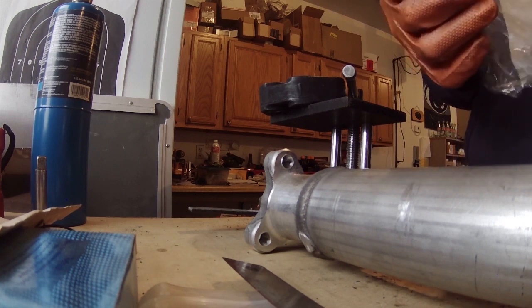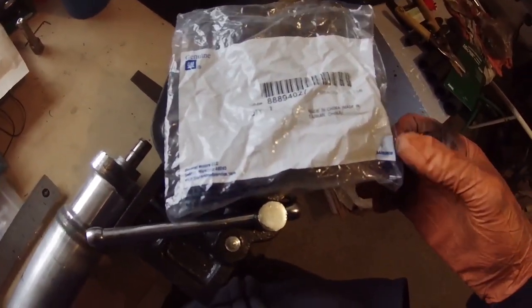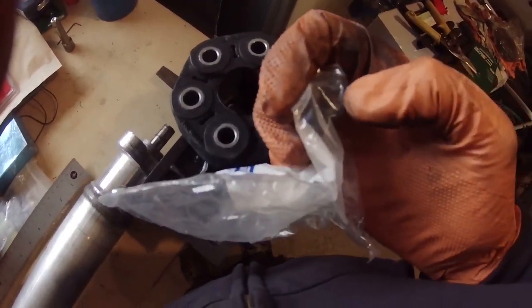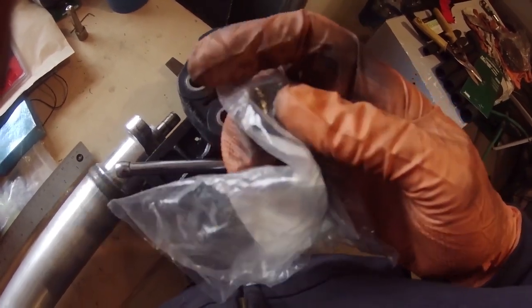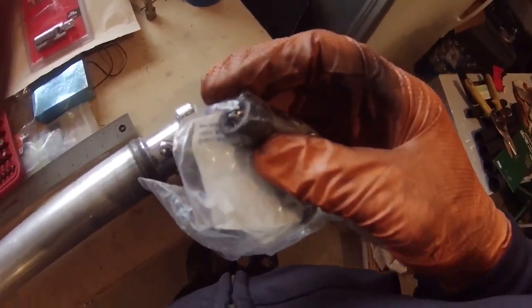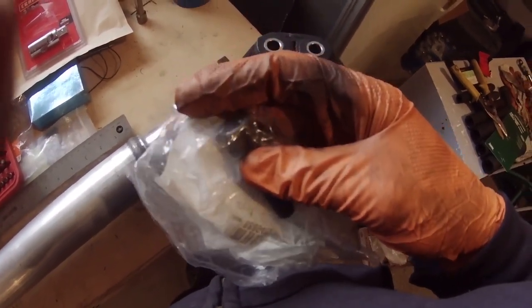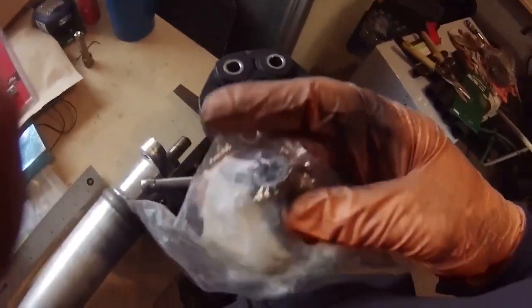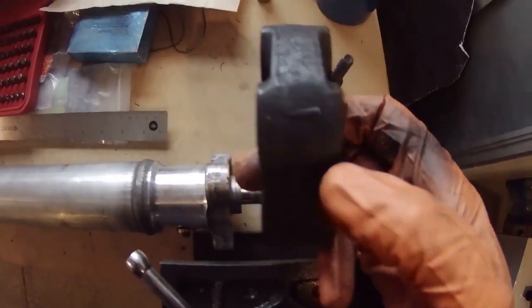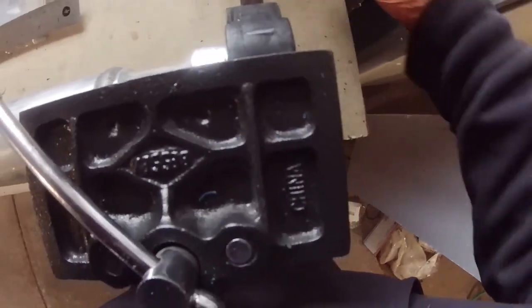Here's one of the bolts I got. It's kind of expensive to replace the bolts - those are like 70-something dollars. But the nice thing about these bolts is the star socket is a bigger size. The ones I took off were T-50 and these are T-55, so a larger star socket means you should be much less likely to break sockets. And these already come with Loctite on them. The arrow on the bolt needs to point towards the flange that it threads into.